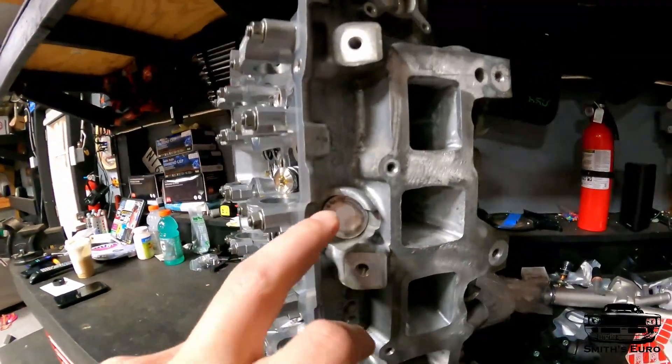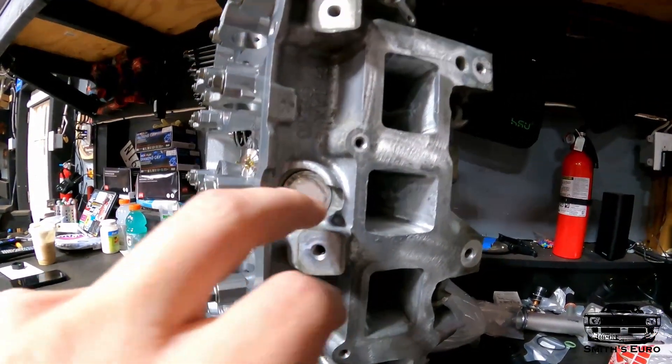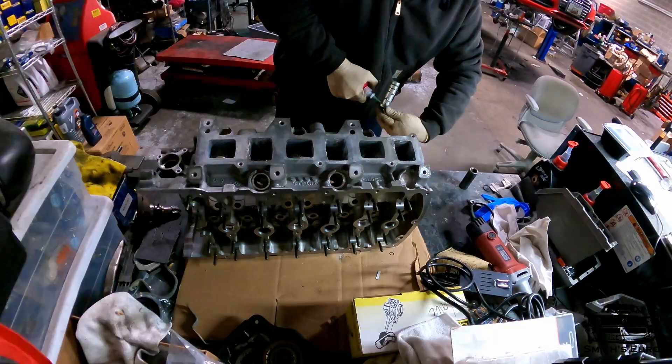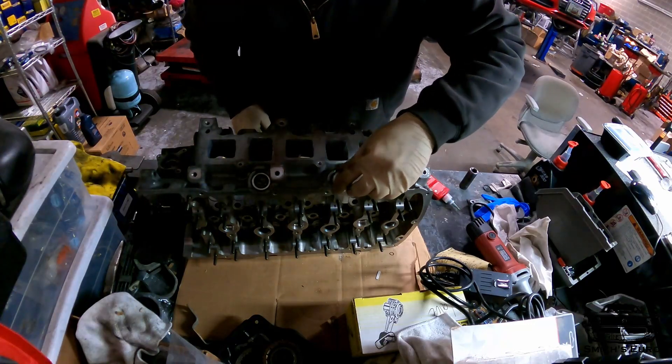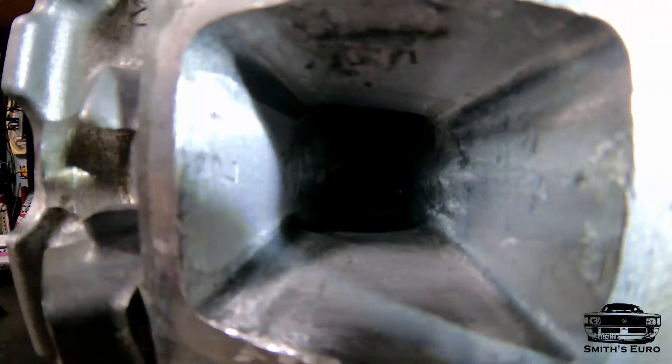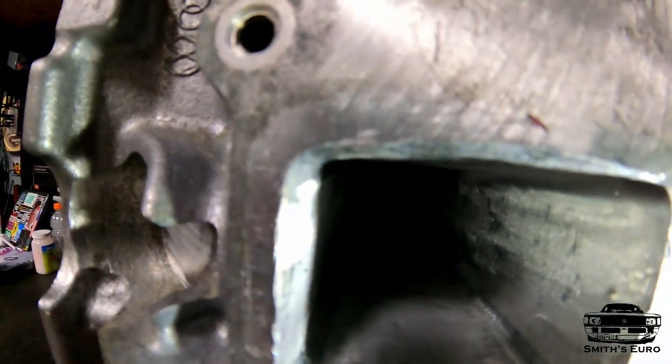There's a saying: I know where all the bodies are buried. Everything that's wrong with this head, or that I think could be better, I know it — and every pass I make, that stuff will be in the back of my mind. These plugs are all different sizes; these injectors are crazy — they're long, they're short, there are so many different size tapers. I made them all as a press-fit so I had to heat the cylinder head up, put the plugs in the freezer, and beat them in with a hammer as hard as I could.